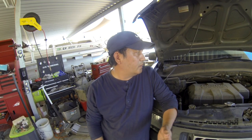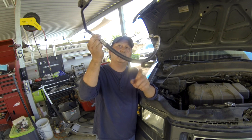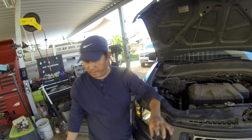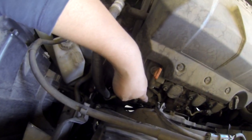Hi YouTube, I got a 2007 Honda Ridgeline. What's going on here is I replaced the AC line right here — it had a leak. You keep adding Freon to it and it still doesn't hold, the Freon is gone and it's empty. This is the line I replaced, it's right in the grill here and comes up and down to the compressor. Now I want to show you how to replace that hose.